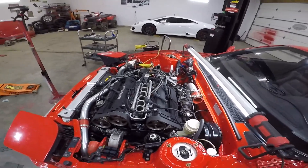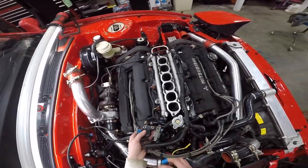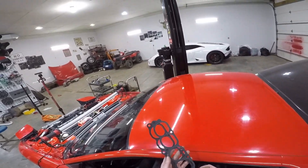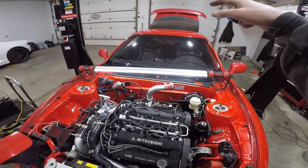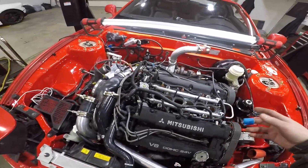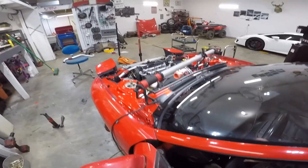Let's put the spark plugs in and get this intake manifold on. Plug wires all in, rear injectors are plugged in, knock sensor's plugged in. I'm actually going to save the OEM intake plan — there's really nothing different, I'm just going to save it for after I change the spark plugs. I almost forgot — I want to put the fuse back in the fuel pump. I want to turn the key and make sure I have no fuel leaks before putting the intake back on. I've got a fuel pressure regulator with a gauge so I can turn the key, make sure I get pressure, and check for leaks.